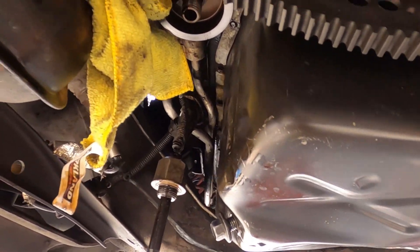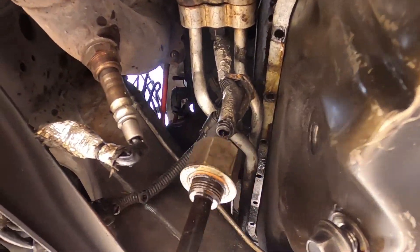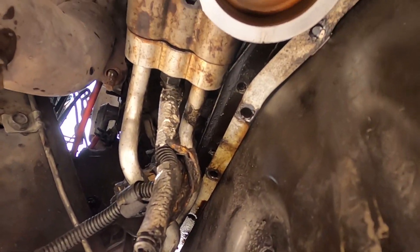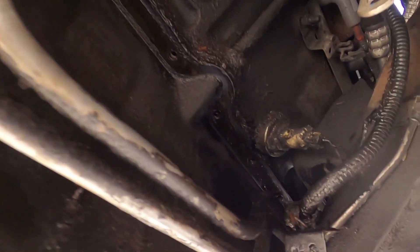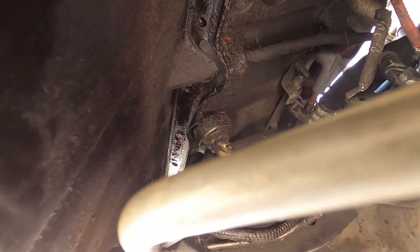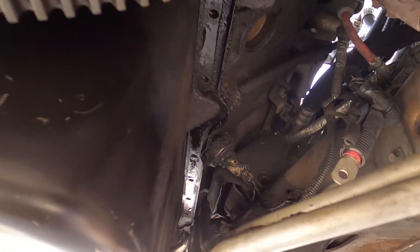All right, that was a pain in the ass — definitely a pain in the ass. We got everything removed that I can think of. We went ahead and removed the exhaust bolts, obviously the oil filter, and all the oil pan bolts. Those are mainly going to be 10 millimeter until you get to the outside edges. The ones with the studs — there should be a few that have studs — those should be a 13 millimeter. The ones in there, there is just nowhere, no room to get a socket, so you had to use an open wrench with a ratchet built in.